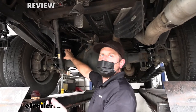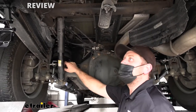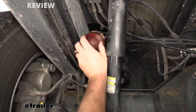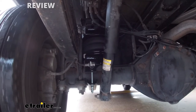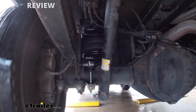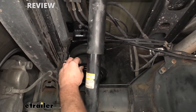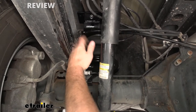Now that we've hit our test course and felt how the airbags do underneath the truck, let's take a look at them. This is what they're going to look like installed — they're just going to take the place of your factory jounce bumper, filling that void between the bottom of your frame rail and your axle, acting as a big cushion. That's what's going to give us that comfortable ride and take some of that work off of our suspension components. These 7500s are 7 inches round — the big dogs — and they're going to do a good job handling a lot of weight, so you can rely on them with a big trailer.